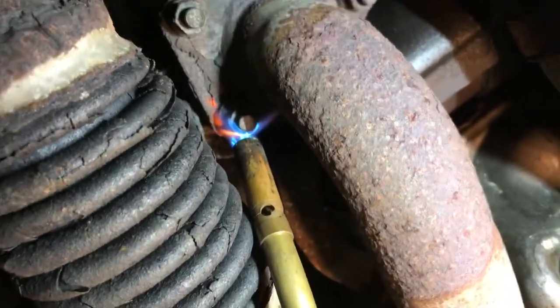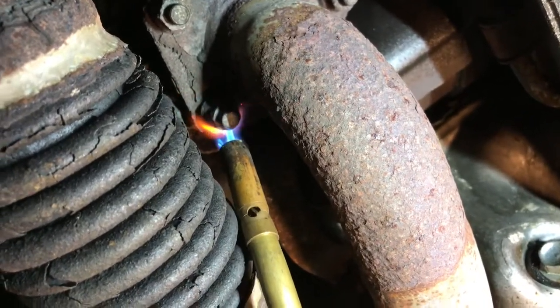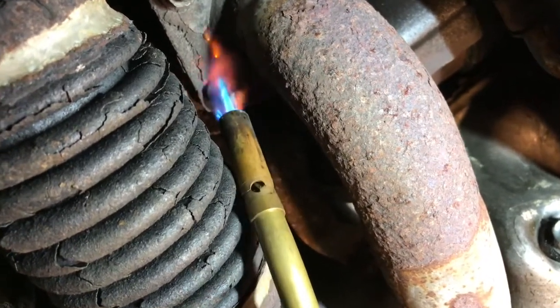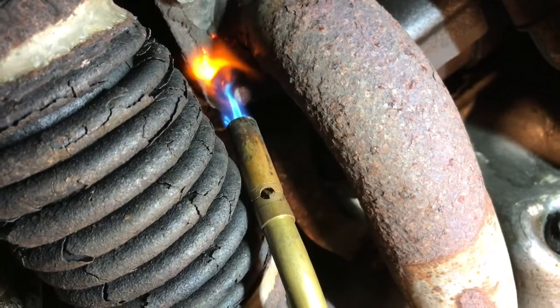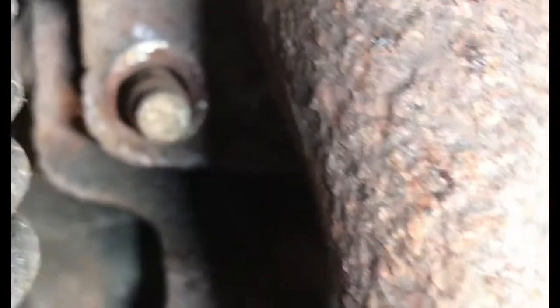I'm going to open this — it's 13mm, and there's a 14mm bolt right there. I have to heat it up — the bolt is very, very difficult and it's not really opening without heat. So you need to heat it up and use a long extension. If you have a breaker bar, you can try with the breaker bar. After I heat it up, those bolts came out. Make sure you have a torch — like a propane torch. Otherwise it's very, very difficult to open.